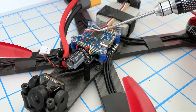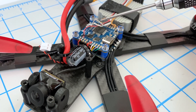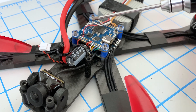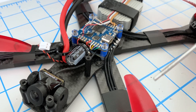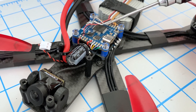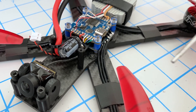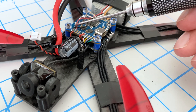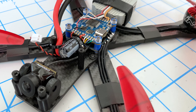If your BEC doesn't have enough power, the GoPro will keep restarting — which is what happened when we initially did this. We had a Hobbywing G3 stack rated at 0.6 amps, and the GoPro would start recording and then restart, recording and restart. That's when we thought we actually screwed up the GoPro. But now we have our positive and negative connected with our connector to our 5-volt pad — links are in the description.